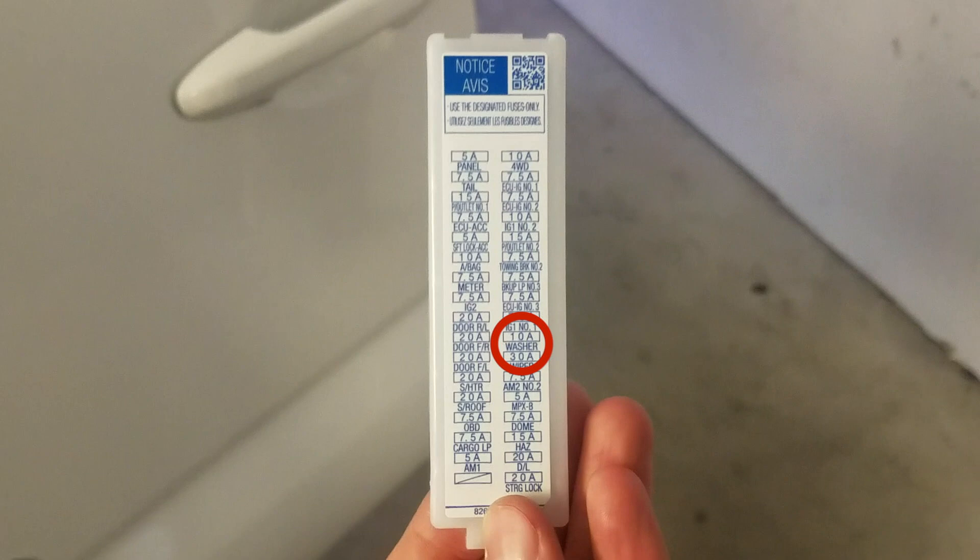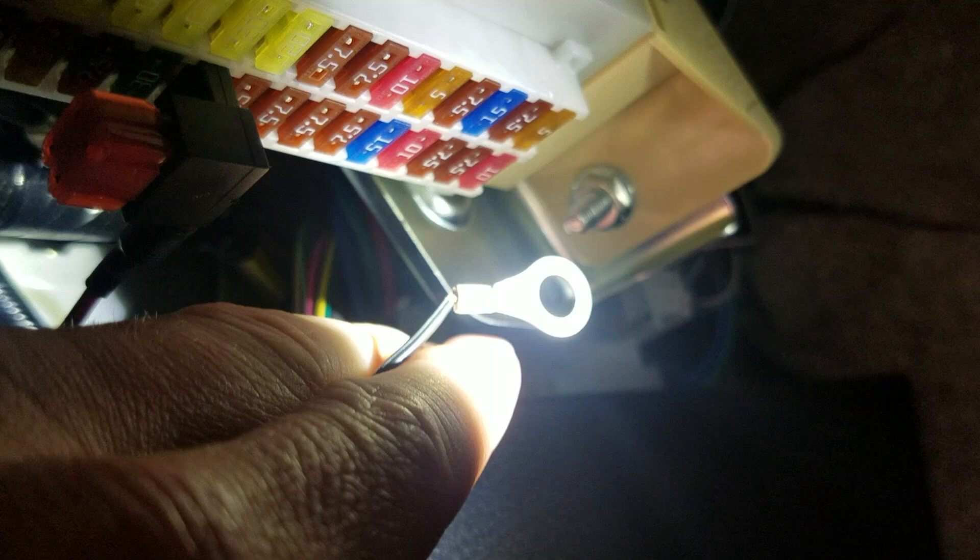The washer isn't that important — it's not like ignition or timing — so let's test that one out and make sure it shuts on and off with ignition. We peel this off, get the 10 amp right there, and pull it out. Orient it the correct way and slide it in nice and easy. The outer, lowest one goes to the radar detector and the one up here goes back to the washer. I'll keep the same fuse ratings for a consistent draw. To ground it, I'm going to use this bolt right here — take it off with a 10 millimeter socket and loosen it.